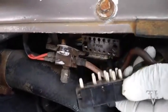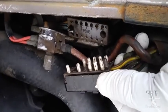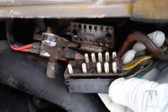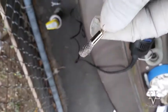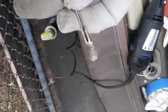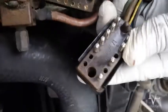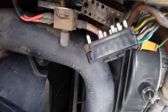Before you actually pull this apart, make sure that you've disconnected your negative battery terminal. This just comes apart easily. These pins need to be cleaned, so I'm going to be using my wire brush with my Dremel to gently clean these off, and I'm also going to clean off the inside of that second portion of the connector.